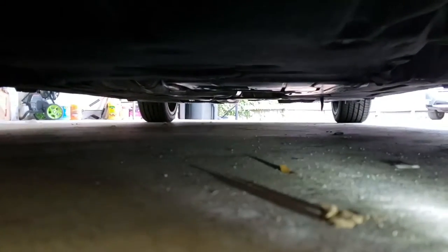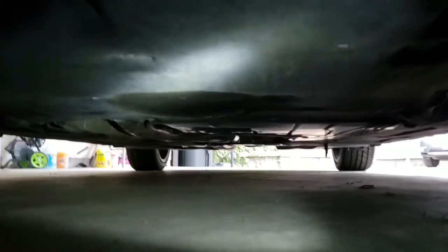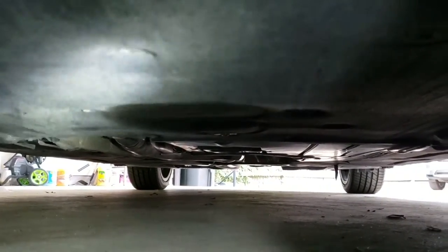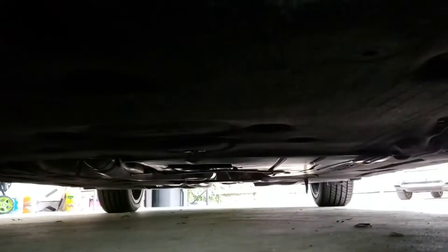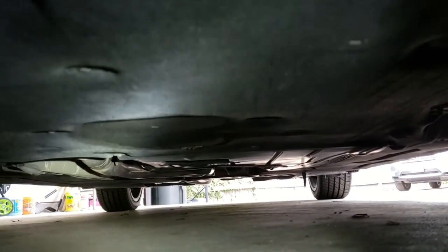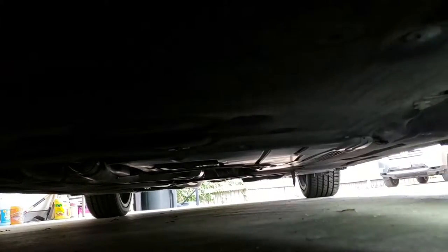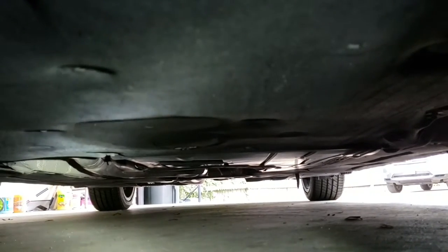The next thing on doing an F30 328i is jacking the car up. As you can see underneath here, it's one big tray. There's nothing really sticking down to tell you exactly where to jack up, but you can see there's an opening there. Come over to the other side, there's another opening there. And there's kind of an indentation there — if I shine my light over, that indentation is where you put your floor jack. You can see there's actually a hole in the middle. That's where your jack is going to go. You want to get your floor jack in there and lift from that point, then put your jack stands in the points on the side to get the car in the air.